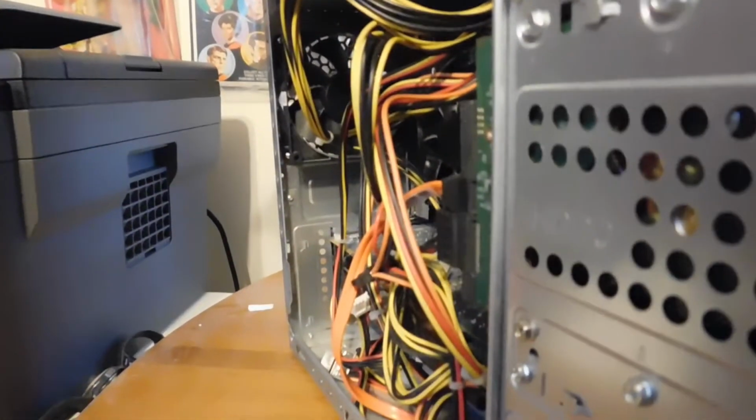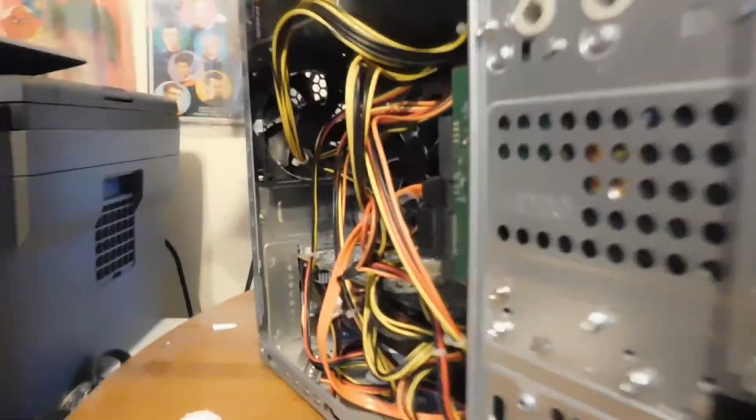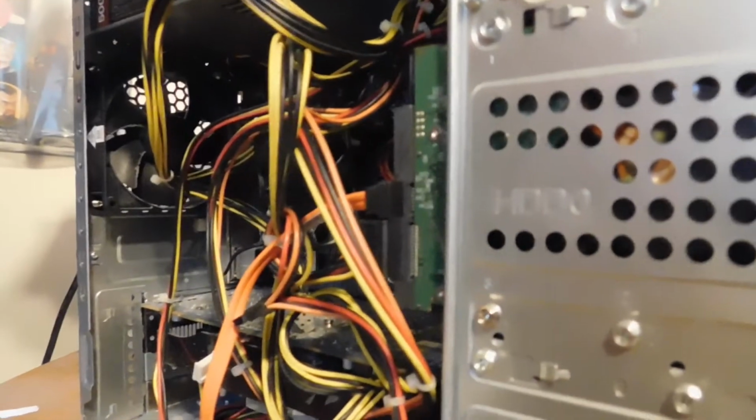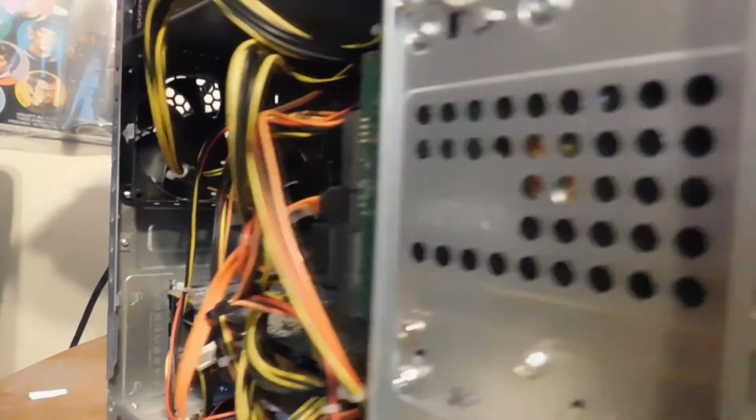Now, when you do the install, you do want to make sure that you unplug the power cable, which is this guy right here, from the back of the system. After you unplug the power cable, hold your start button in for about 5 seconds just to make sure that everything's been discharged. If you touch some metal part of the case, you should be okay for anti-static. People say you've got to do it on an anti-static mat and wear a wristband and all like that. I mean, as long as you're not shuffling on a carpet, like shag carpet, you should be okay.